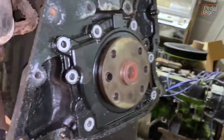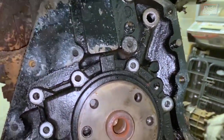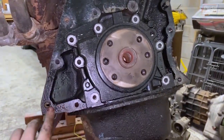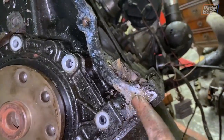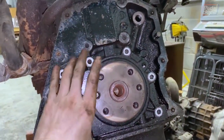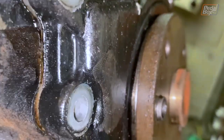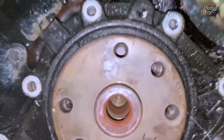Now that we've got all that stuff off the end of the engine, I'm going to try bolting into these two bolt holes at the top. They're only small but they're the best I've got, because that one is actually larger than the through holes on my stand. I'm just going to go to that one on the bottom there, run a big old length of rod through with a nut behind it and one onto here. What I'm basically hoping is that all of the little arms coming off the engine stand span wide enough that when we take the crankshaft out later, this seal unit — which kind of wants to pop off the end of the block — is held in place by this inner ring which is held in place by this flange here that I can't work out how to remove.